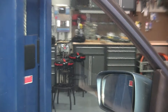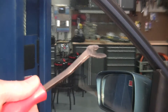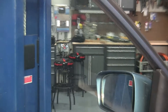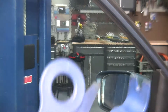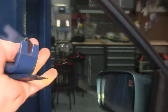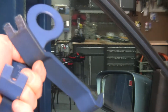A couple of tools that really come in handy. This little one here is for getting up underneath and lifting off the little push-clip retainers that secure your panel to your door. Do be careful with the metal tool — get something between the metal and your paintwork so you don't scratch things. These plastic ones are a little bit better; if you get the stiffer one, sometimes it's enough. The plastic ones are non-marring so you can pop those connectors off without damage.